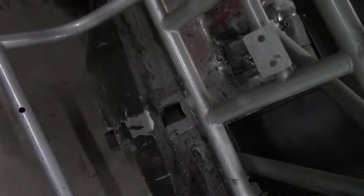And since we're going to redo all that, we're going to grind those down. We're not going to have these diagonal down bars anymore. And then eventually we'll get those back ones cut out where the torque box reinforcements were. But that's where we're at. Now we can start grinding on everything, getting it cleaned up, making our plates, getting our frames tied back in together using 1.5 inch chromoly, and cap off the ends of the tube that was down on the 1/8 inch plates before.